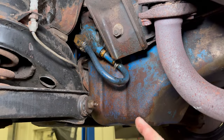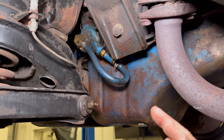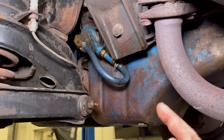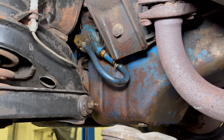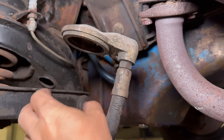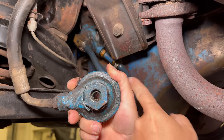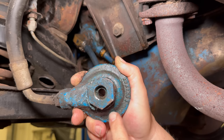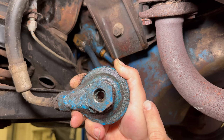The engine in this car is a 260 cubic inch Ford V8. They used this engine in a lot of vehicles, but the Sunbeam Tiger probably leaked more than the rest of them. In order to fit an oil filter in this engine bay, they came up with this remote oil filter adapter. Your filter would be right here, and you would have a hose that went down to the engine here — you can see this is the same thing that's on the side of this engine, and they've just looped a hose between the inlet and outlet.